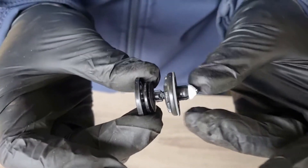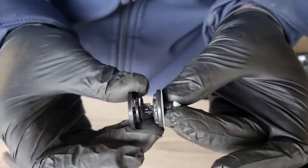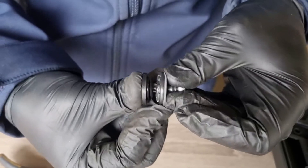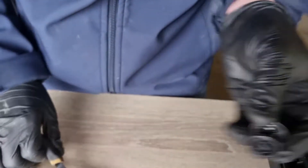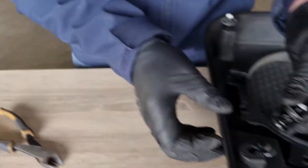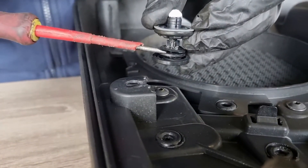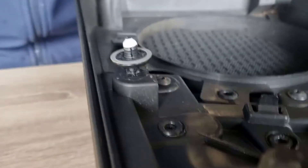When refitting, the white collar should be pushed up against the clip. Push the door card back on into the hole and as you bang on the door card it will push in and spread the tabs out. Make sure you go around each clip, reset all of them into that position, and refit them onto the door card. The door card slides in between the two parts, and it's ready to refit.